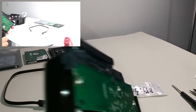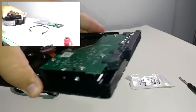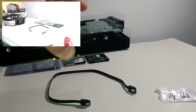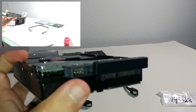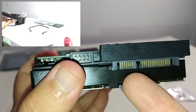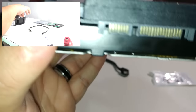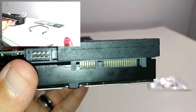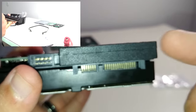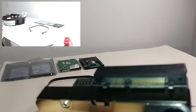There it is — with the adapter installed and glued into place. When I mount this in my Mini ITX server, it's going to be facing down this way, so this L-shaped adapter was ideal for my fix. I want my power and data SATA cables to come straight down into my motherboard and over to my power supply. You may need a left or right angle adapter — they make both — depending on how you want to orient your hard drive in your chassis. Make sure you look at that before ordering an adapter to fix a broken hard drive.